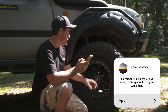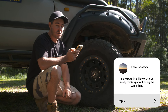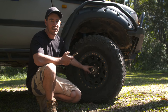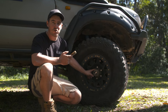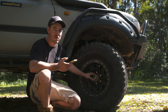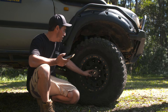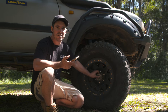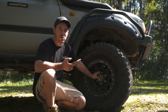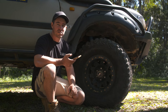Sooty has a part-time kit. The 80 series, except for the base models, are all full-time all-wheel drive and don't have manual locking hubs. Mine came with a part-time kit already in it and I love it — I wouldn't change it back. It's quite a bush-proof setup where you can disengage one wheel, which you can't do with a full-time four-wheel drive. It just works — I haven't had any dramas.